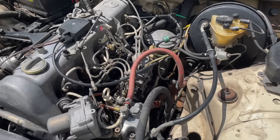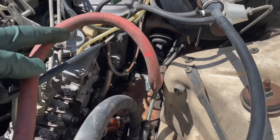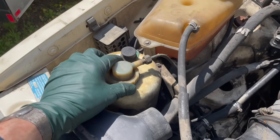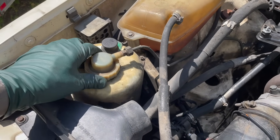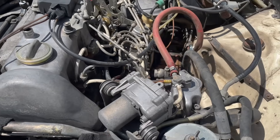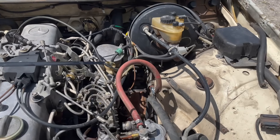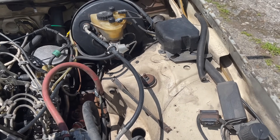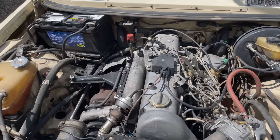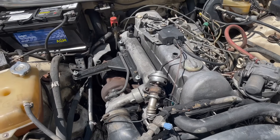Look at that airline used as a fuel hose — it's already starting to rot through. I looked over at the SLS fluid and it's empty, so you want to make sure you check all the fluids. That's kind of a nice sign when you've at least got oil in the engine. But you don't want to start one of these up and run it very long until you've given it a thorough inspection, particularly checking all the fluids.